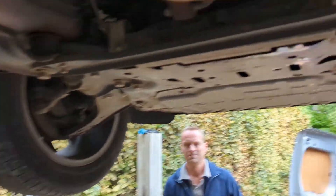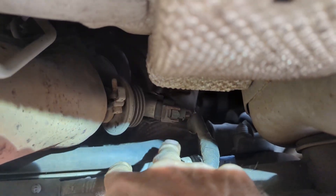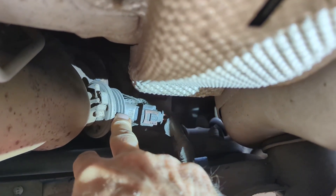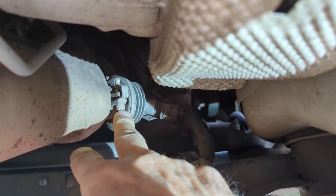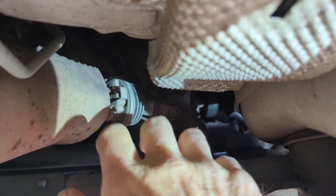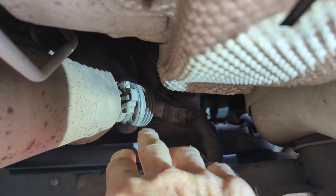Looking up in that orifice, there's the main exhaust, there's the engine up in that bay up there. Here is the DEF injector — my man with the torch is swooping in to help. There is the connection for the actual solenoid on the injector. This is the DEF or AdBlue injector held by a T25 or T30 Torx screw in position. The other advice is to undo that screw, withdraw the injector and inspect the end of it, see if there's any crystallization or contamination on it. So when we get it off, we'll have a closer look at the actual nozzle.